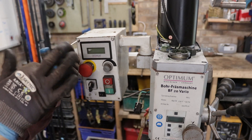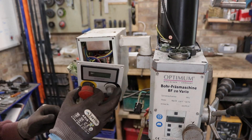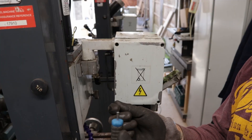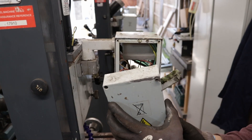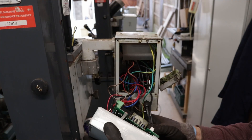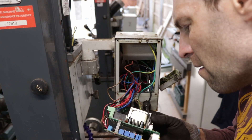I proceeded with the electrical fault on Tom. The machine never powered up — you plug it in and there were no lights, nothing, and the motor wouldn't spin. Someone had been in the back of it. I presumed it could have been a faulty safety switch as some switches were hanging out and didn't look good. Looking at the front and back board there were no visible signs of any issues whatsoever.